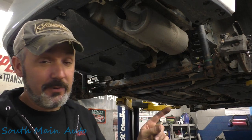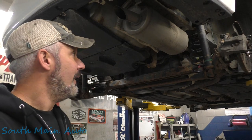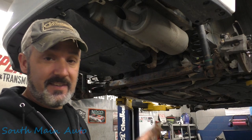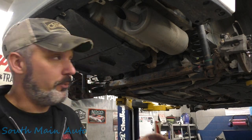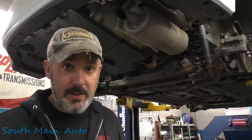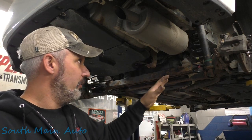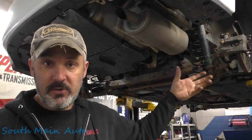And then when you clear the code, the circuit doesn't come back immediately. You have to key off for a certain amount of time. So I find that this is the easiest way to not get led astray down the rabbit hole of, I need a new ABS module because I don't have my 11 volts back here. Like I say, Toyota's pretty good. If it doesn't work, everything here stays alive.